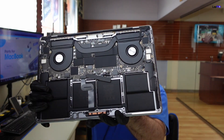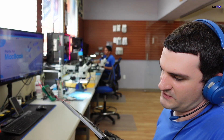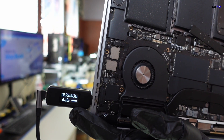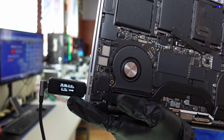So we have this here. I don't see any type of liquid spill obviously right now, but probably if we open it and go to the other side, it's probably going to be something pretty obvious there. Let's check our voltage, especially under the battery, and see if there's any changes. So let me plug it in. The voltmeter can tell you a lot about what's going on without taking a quick look. So you see here — you're getting 20 volts, the amperage is going up: 0.27, 0.3. Now back down to 0.27, 0.1, and it dropped all the way to about 0.01. So there's something going on there — most likely there's some type of short.